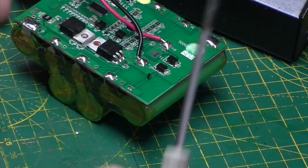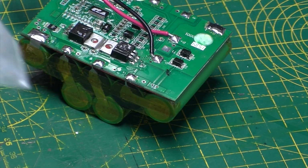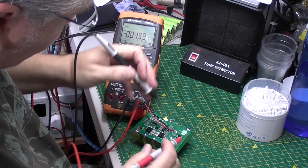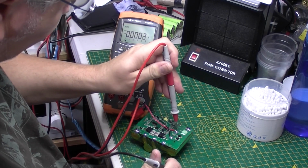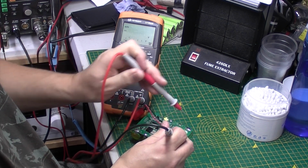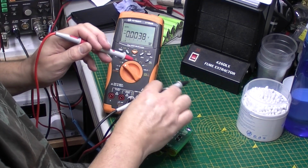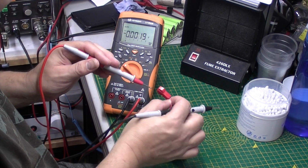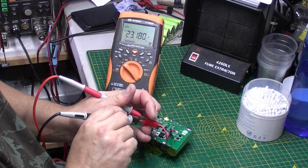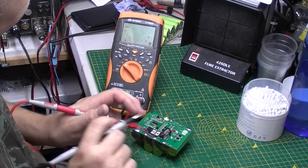That looks good. So now that we're connected back up, let's have a look to see if we've got that voltage on the positive and negative. Just a quick clear up of the bench, so nothing's going to short this out. So let's have a look now what we've got on positive and negative here. Now we have 23. Oops. Let's just do it in the plug, it's easier, isn't it? Volts, look, with it in circuit.